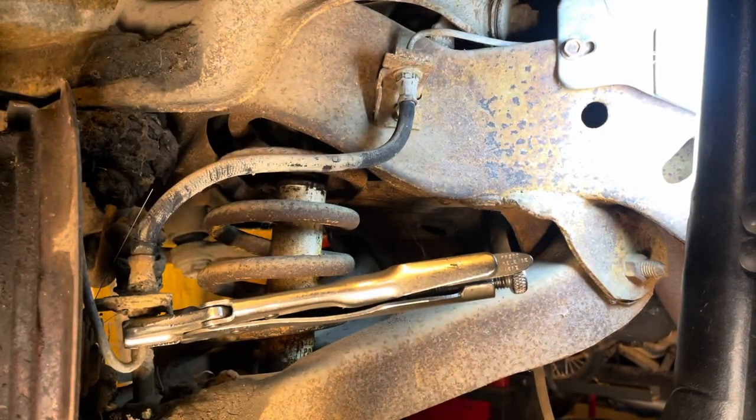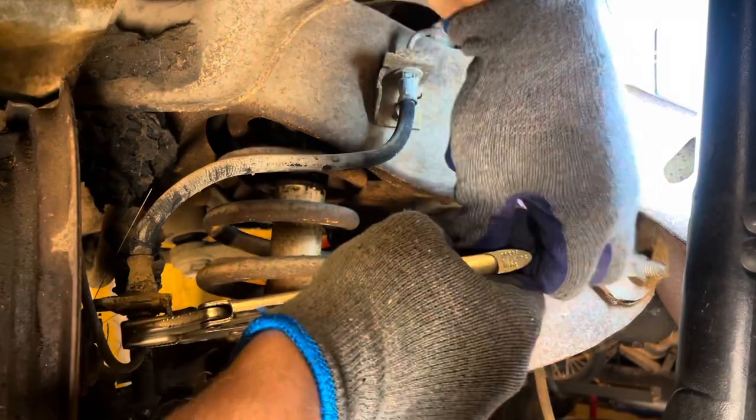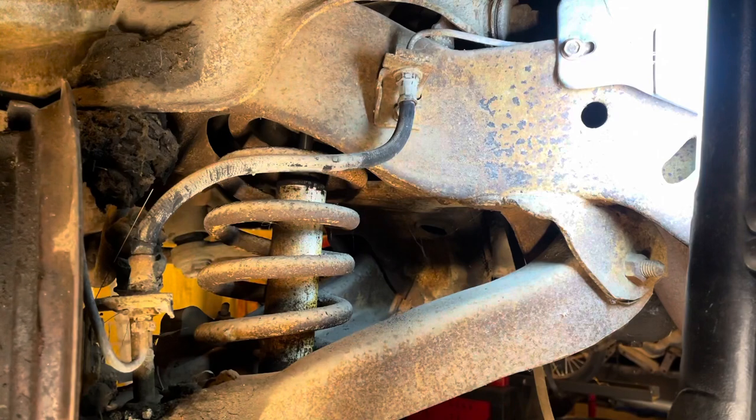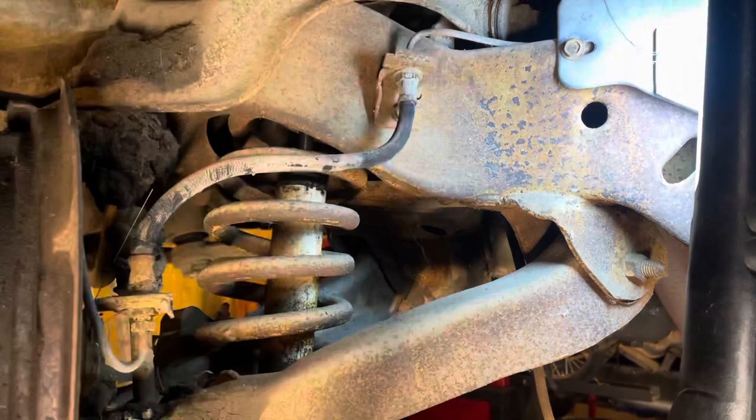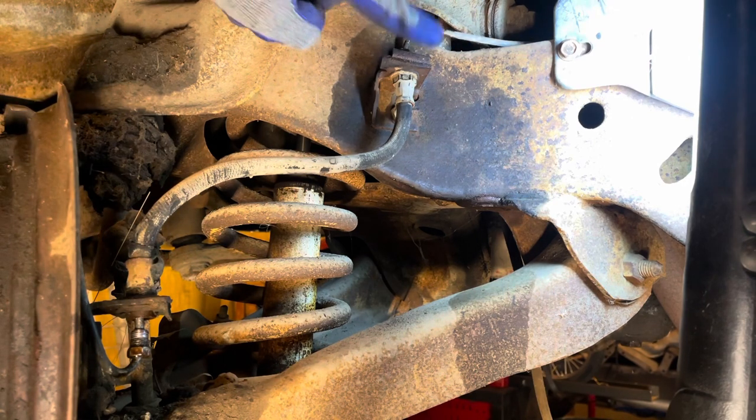Now, you can squirt a little lube on there and a little there. And use an opening wrench. Start backing that puppy out. Then you can just give it a little squirt of brake cleaner and spin it out with your finger. All right, I got both these out. No damage at all. Next thing you need to get out are these.